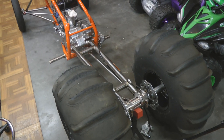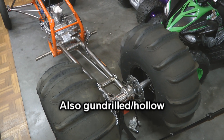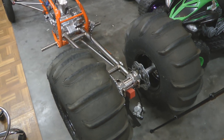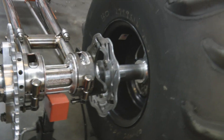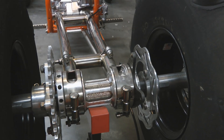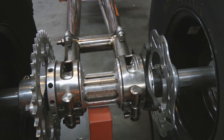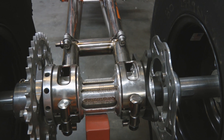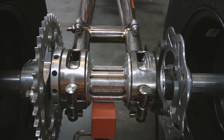Over in the orange corner we've got the dedicated drag bike. It has a JJNA aluminum drag axle that's been cut down a couple inches. Tires and wheels are 25-12-9 and 18-inch staggered extreme sand tires on 9-inch Douglas blue label wheels. All the hubs have been cut down, the keyways are aluminum, and the sprocket and brake rotor are aluminum — pretty much everything done to lighten up the rotating mass. In the center there's a Lone Star Racing rear bearing carrier cut down by GT Performance — that's Garrett Thompson out of Kansas, and he's really good at cutting carriers.